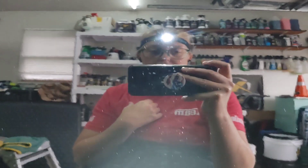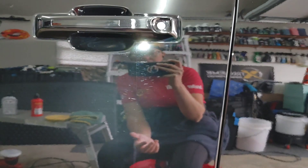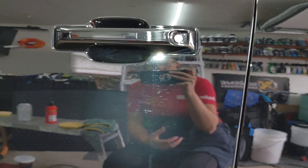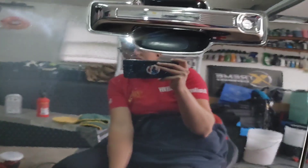This is a brand new vehicle, under 8,000 miles on it. Here's the condition of our paint kind of before we start polishing it. You can see we've got some light swirls and scratches. The customer says he pretty much maintains this using ONR or rinseless washes. But I'm finding that this paint is exceptionally soft, which from a detailing perspective means it is very easy to scratch, very easy to correct. But it can also be finicky in that it doesn't want to finish down properly.